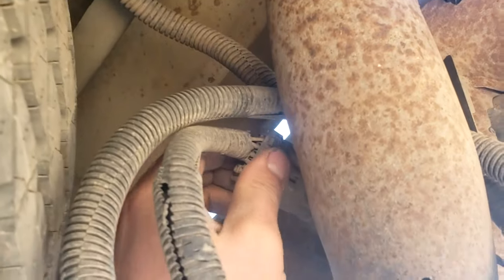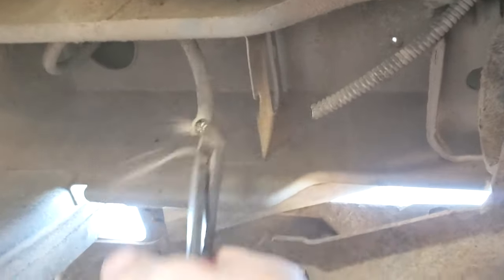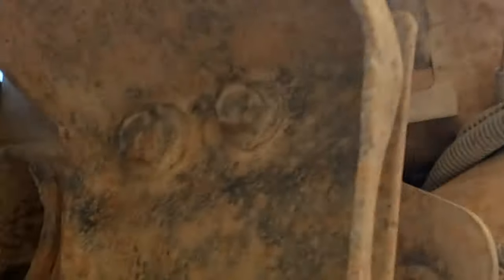Same on the other side. My license plate light is already disconnected. The trailer lights are just a plug in the back — easy enough. Now that I've cut the wires to my taillights and got all the other wires out of the way, we'll go ahead and remove the bumper, which is just a couple bolts on either side. It's a 21mm for the big bolt.